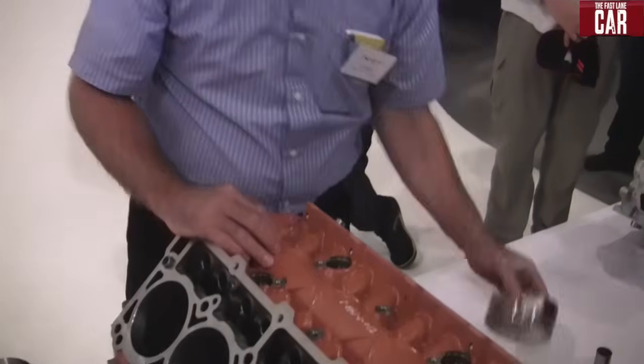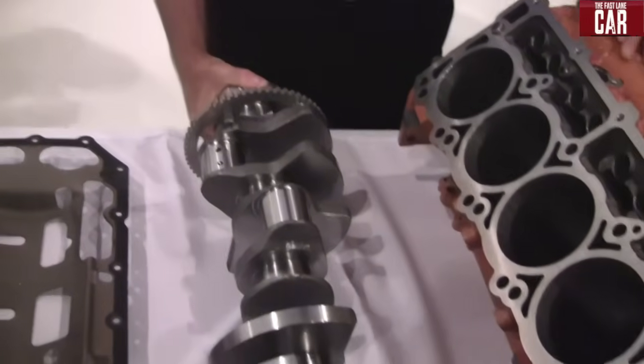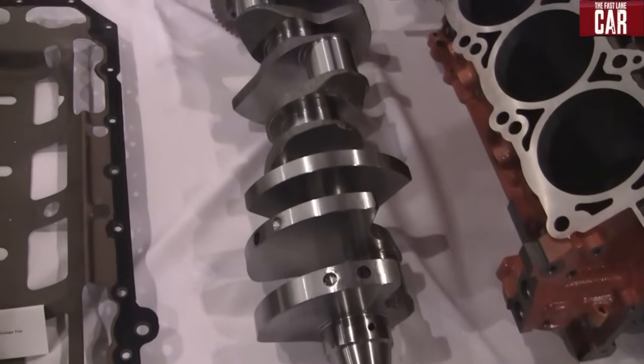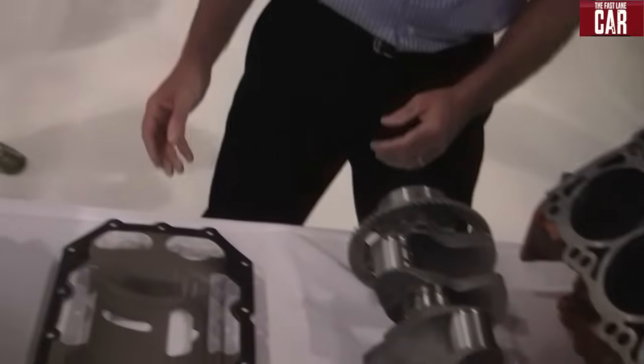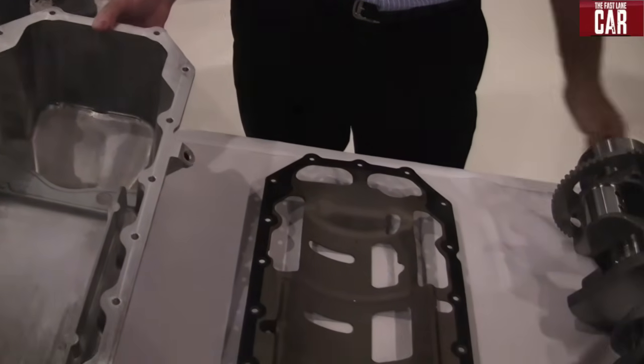For the 6.4 liter, we have increased oil flow to handle the increased output from the engine. We also raised the compression ratio — the outgoing engine had 10.3 to 1, and this engine is 10.9 to 1 compression ratio, which improves engine output as well as fuel economy. This engine also has a forged steel crankshaft with increased rolling pressures for improved fatigue strength. We have also modified the windage tray in the oil pan to work with the revised casting for improved windage.